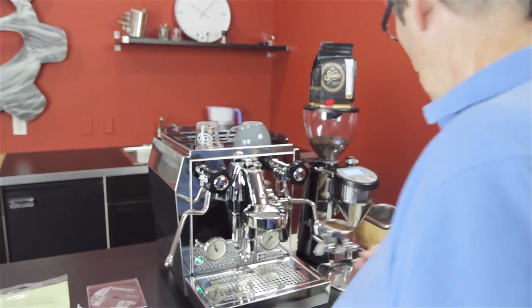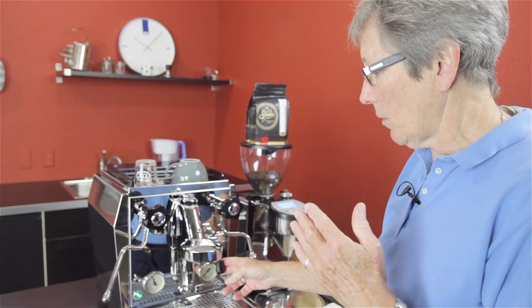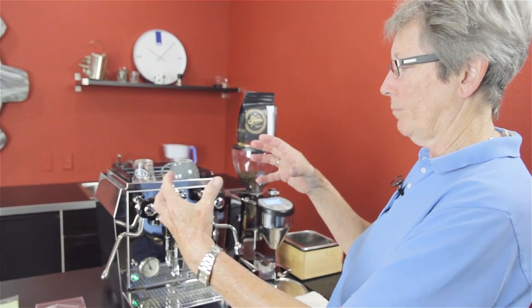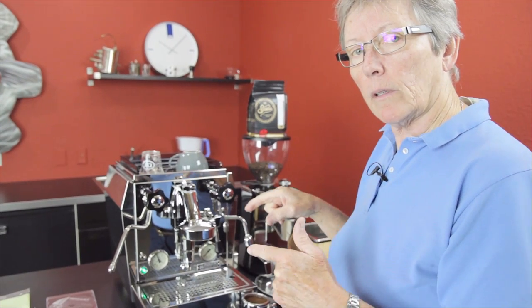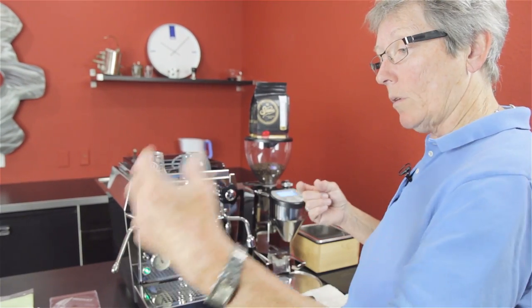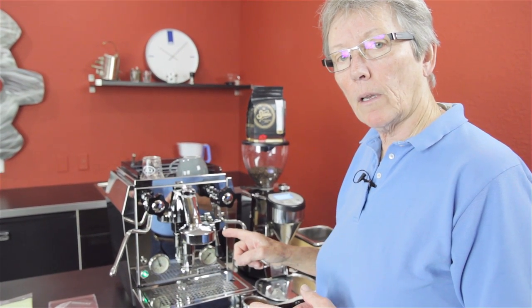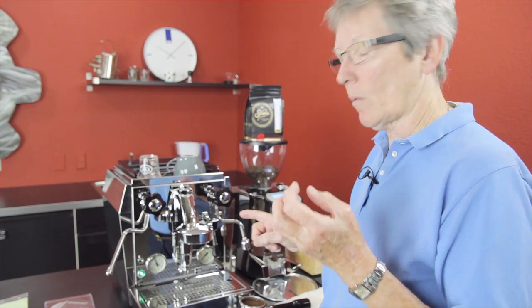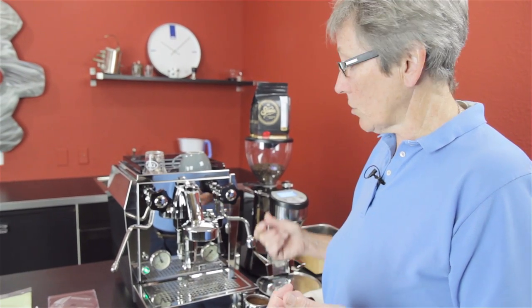The other thing you want to do on a heat exchanger machine before you actually brew, if it's been sitting for about five minutes or so, you want to do a purge. How a heat exchanger works is it's a big boiler — three-quarters full of hot water, and that other quarter that's empty is where your steam comes from. That water is actually at steaming temperature, which is much higher than brewing temperature. Within that water, a tube goes in one end of the boiler, it's sealed, comes out the other end, and that's what feeds your brew head. The time it takes for that water to get from point A to point B, it collects the proper amount of heat to give you the proper temperature at your brew head. If the water is sitting in that steamy water, it's too hot — so you want to purge about seven seconds or so to circulate that hot water out of there.